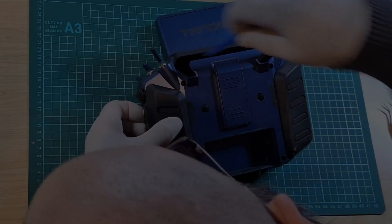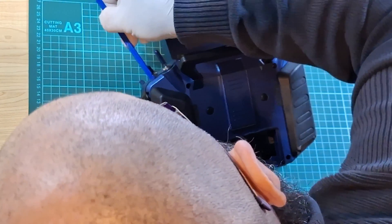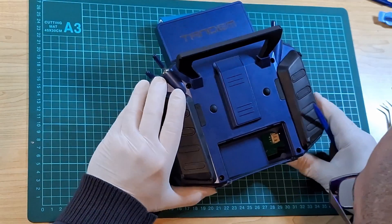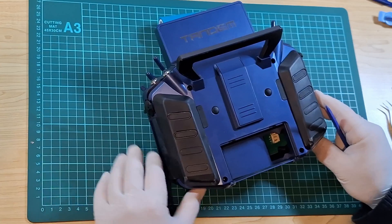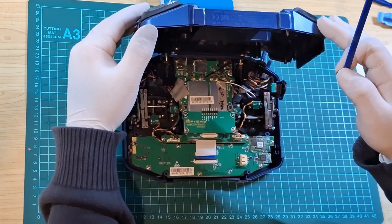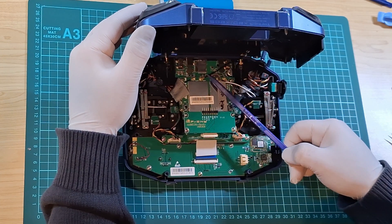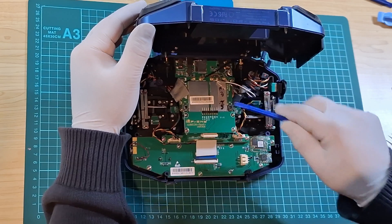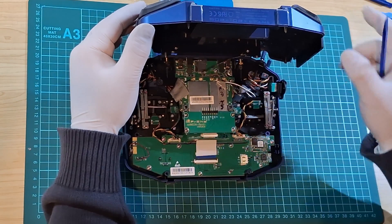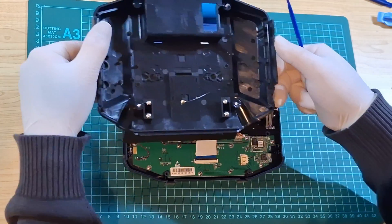Take your time loosening the back case. You might experience a little difficulty near the left and right slider switches because they're attached to both the top and bottom part of the shell. If that's the case, simply push the slider down off the back cover. Now grabbing the bottom of the shell, gently lift and pivot it to a 90 degree position. You'll notice a coaxial cable from the back cover to the RF board — that is a 900 megahertz antenna which sits inside the handle. Go ahead and remove that now, then you're free to remove the back cover.